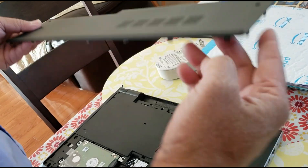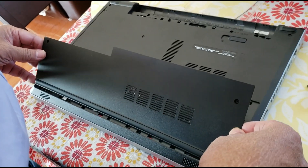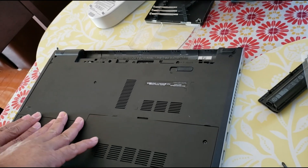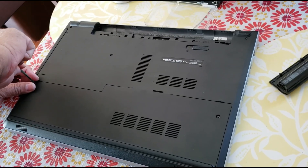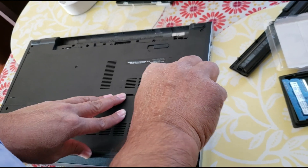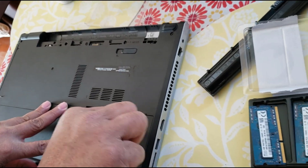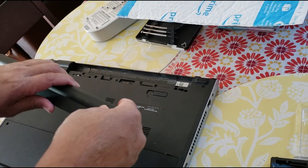When you put the back cover on, there are seven tabs — tilt it until you hear the click so the cover sits flush. Don't screw it too hard; there's no need for too much torque as these are very delicate screws. Then put the battery back on.